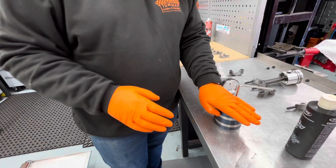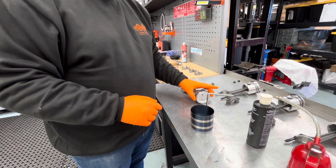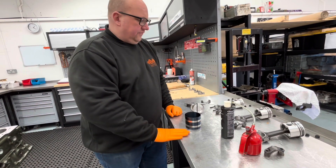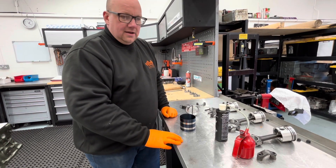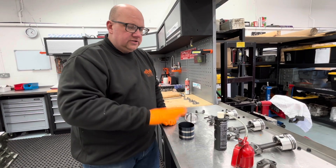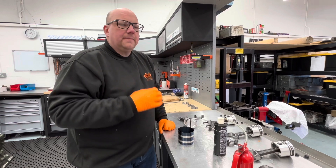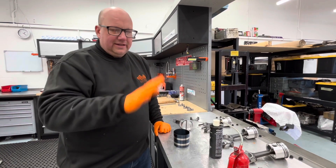You have to be careful doing this operation. It is possible to break piston rings, but I think you have to be quite ham-fisted to do so. Touch wood, I've never broken one. If you come up against any resistance when fitting these pistons down the bore, stop. If you end up battering pistons down the bore, you will break things. So stop, take your time. If something's tight or it's got resistance, something's wrong — stop, check, have a look, walk away, come back.